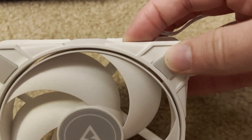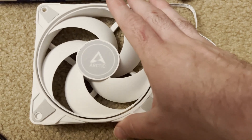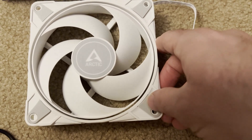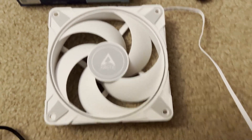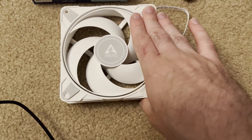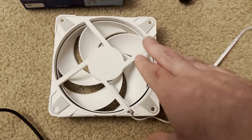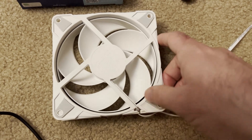The gap around the outside is not the best but is pretty good. To get it even narrower, they'd need to use fancy materials such as liquid crystal polymer (LCP), which would drive up the cost of this fan. So they've done an excellent job especially considering the price. The move to a fluid dynamic bearing should help with noise profiles, particularly at lower RPMs, which I do believe I saw in my testing.